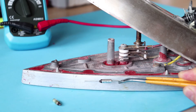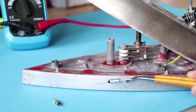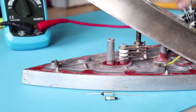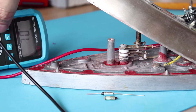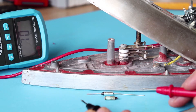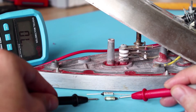A thermal fuse is a safety switch that allows the flow of current that heats the plate of the iron to be interrupted if the temperature gets too high. It's a safety mechanism to avoid the melting of the internal circuitry. First thing you need to check is that your thermal fuse has continuity of current, because if it does not, you need to replace it with a new one. It's a small piece and costs about three euros or four to five dollars.